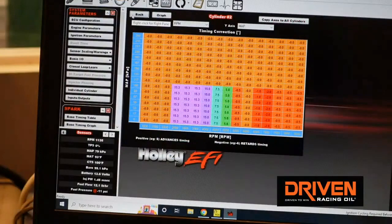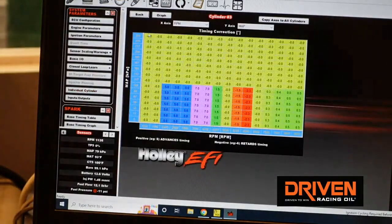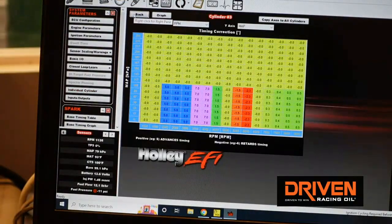When we started doing that, we have our normal ignition timing table and then we have trims — eight different ignition trims for each cylinder. And then every couple hundred RPM, we made spots to vary it. What's wild is how different the cylinders are from each other and how much they'll change over a range of RPM. You'd think it would have some predictable slope, but no — it'll be like add 9 degrees, then the next box you might be taking away 2 degrees, the next one you're adding 12. Literally 10 degrees spread of timing cylinder to cylinder and from RPM range to RPM range.